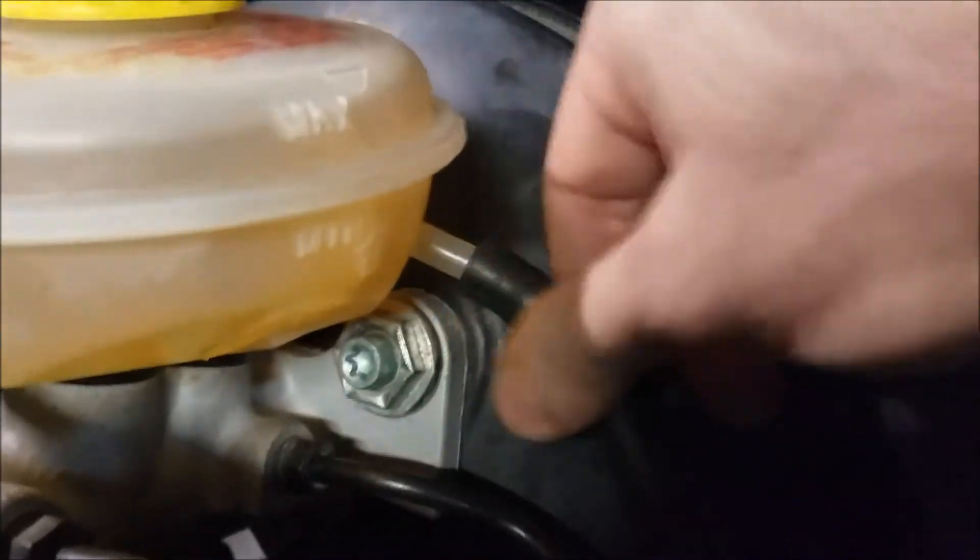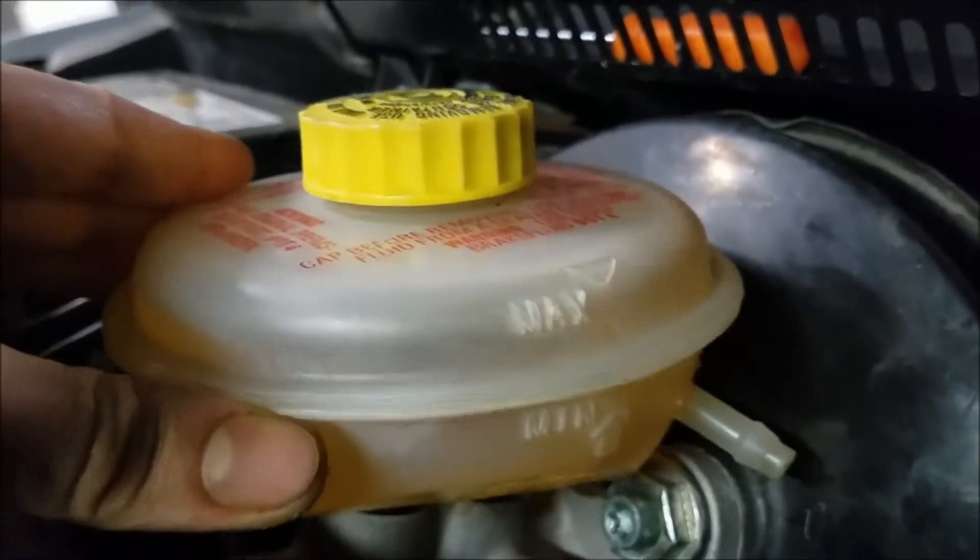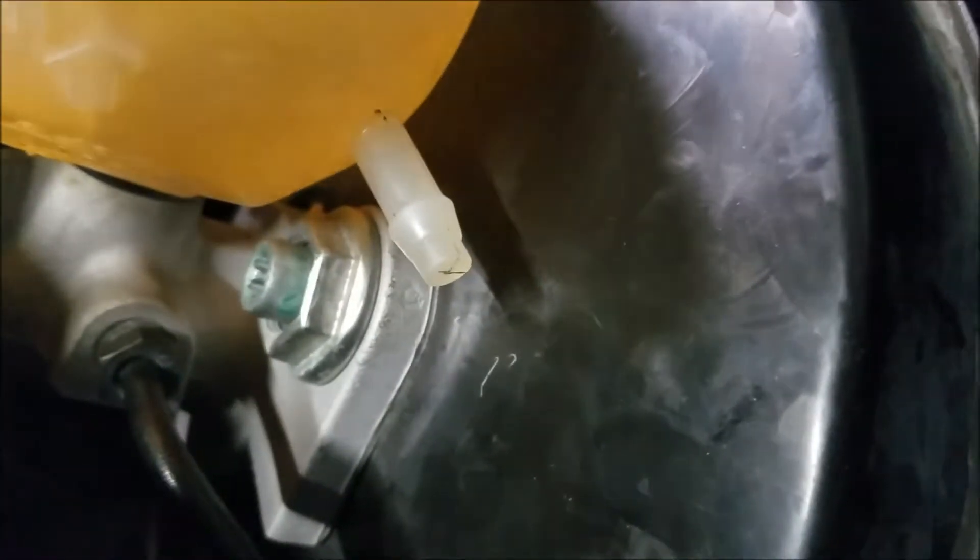Well, it's not doing that. As you can see, it's full, but there's no fluid coming out — because somebody had replaced the brake master cylinder with a new bottle and not cut the nipple off of the hose barb to let the fluid down into the clutch.